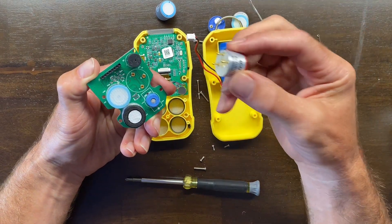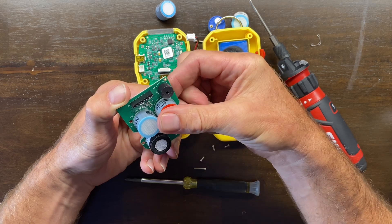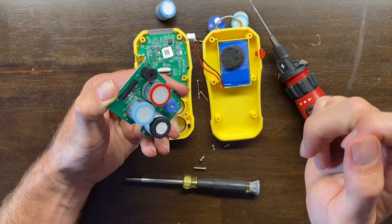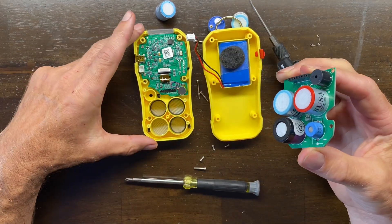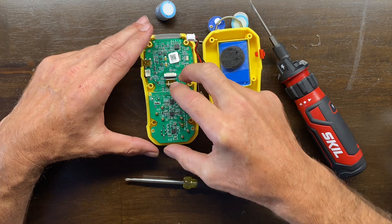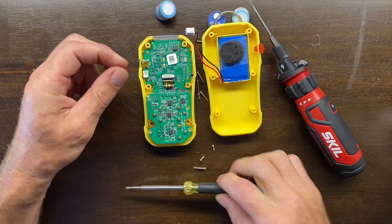Hold the new sensor with your index finger and thumb. You can't make a mistake because it's polarized — the electrode configuration is asymmetric, so it will only go in one way. Have confidence, and insert it. You've replaced the sensor and cleaned the PCB and electrodes. Now slowly ensure the O-rings and grills are in place, line up the pin connector, place the sensor board back in, and press it down with your thumbs until it's rigid and secure. If anything is loose, start over.